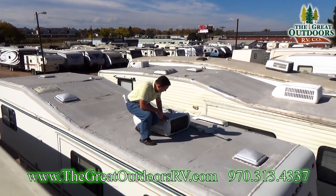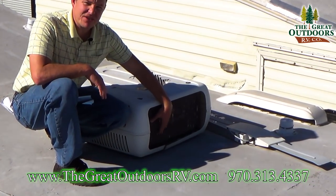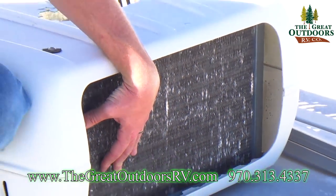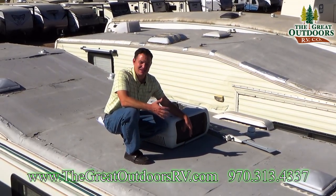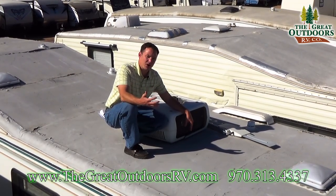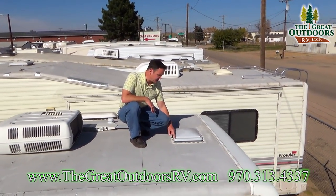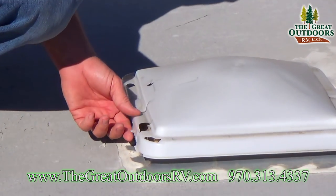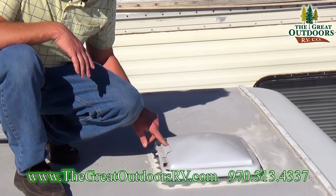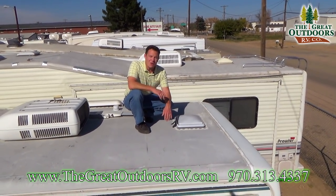While you're up on the roof, check the back of the air conditioner. If the fins are all bent up, that means it's probably been in a hailstorm, and the AC isn't going to work nearly as efficiently — it can freeze up a lot easier when it's constantly running on a super hot day. Also check your vent lids; in hailstorms like we get a lot in Colorado, these can get cracked and have holes punctured in them, which is a disaster for water getting into the coach.